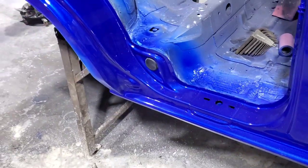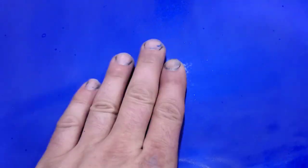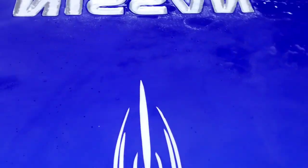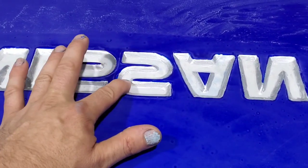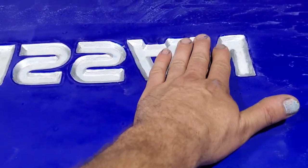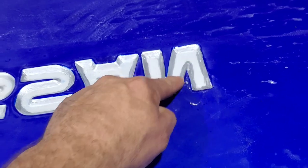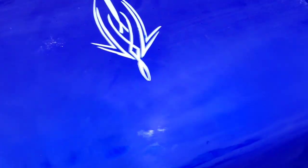I'm about ready to put the frame and everything back together. I haven't shot a video in a few weeks — I have had a lot going on. I probably should have been working on this hood with a video. I got a lot of fish eyes, and you can see a couple fish eyes here and there and a little bit of trash in this hood. I'm not happy with how this hood has ended up, but I'm gonna have to just push through this. I ended up putting a light pearl in here — I'm doing some of my stuff with white pearl — and then I took a brush and brushed silver along where it slopes down and then painted the blue on top of that.